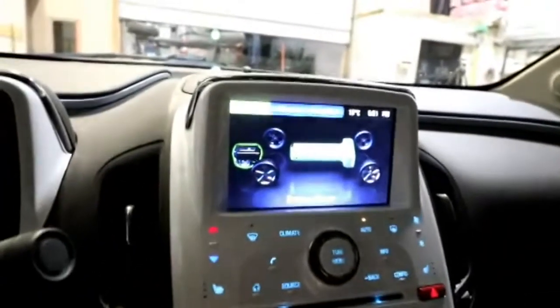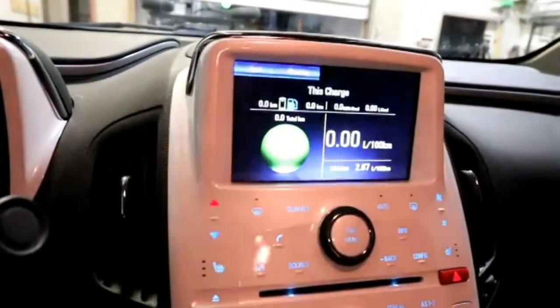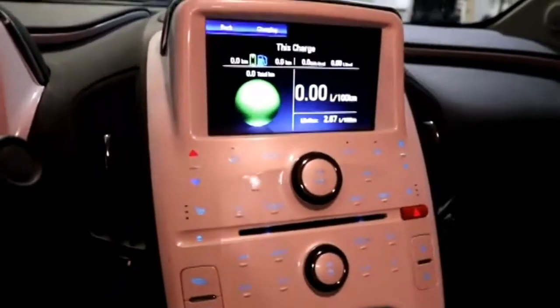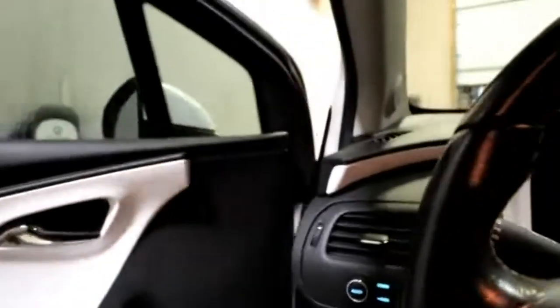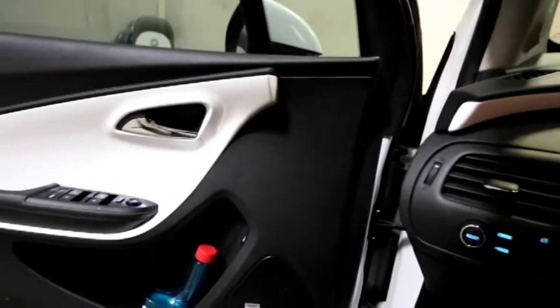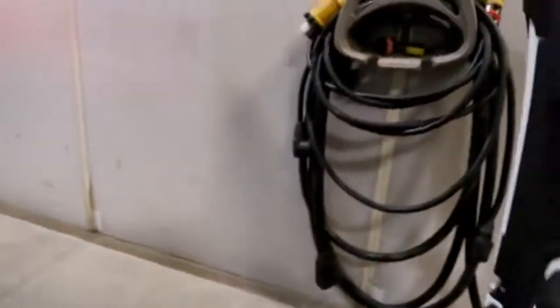When we turn off the car — go silent so you can hear — you're going to hear a little swoosh. It tells you information about your trip before you get out. We do have our gas release button down here, which actually depressurizes the gas tank. This car actually pressurizes the gas tank, helping it run on a smaller tank and be more fuel-efficient.